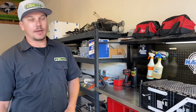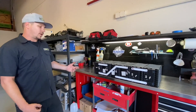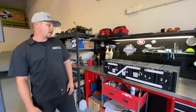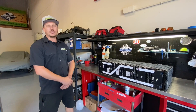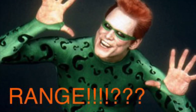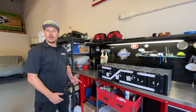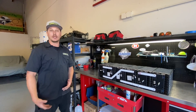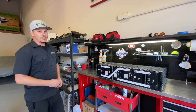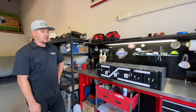This is going to be the rear battery pack going in the car. It's going to be composed of six LG Chem batteries. We're going to run it in a 2P configuration — six in the back seat and six up front mounted underneath the hood. This battery is the LG Chem; it's going to be a 32 kilowatt-hour system running at 400 volts. We're shooting for around 100 to 110 mile range, but until we actually get the system running and the car driving, we won't know specific details. This is the same battery setup we use in our Porsche 911 kits as well as our E36 drift car and a few other builds.